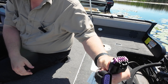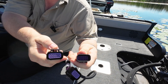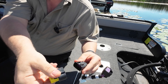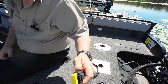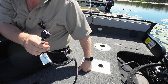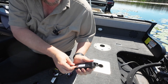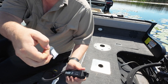Now what we need to do is take off the weather guard from one end of the harness — it pops off just like that, and you're going to save that weather guard in case you ever need it. Then we're going to take our terminator and plug it in where we pulled off the weather guard. Make sure you listen for the click so that it's seated properly. There's also a first piece of plastic we need to pull off — it just says 'end user remove mask' — so we'll pull that off.